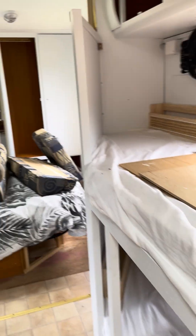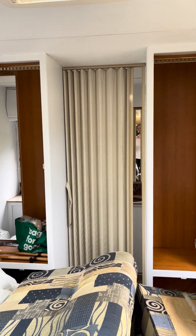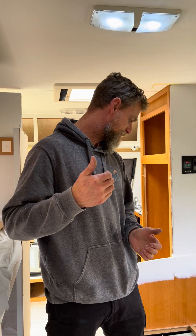They've got the main couples area at the back, the bathroom and everything. They're renovating at the moment. When we first started talking to them we were going to put a fairly reasonable off-grid package into their vintage van, so instead we've just transferred it into this van. It's a 560 amp-hour battery system with a 2600 watt inverter, and we've got 1300 watts of solar on the roof — there's still actually space for more panels up there if needed.